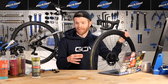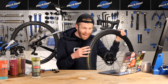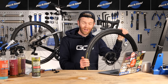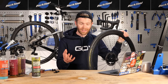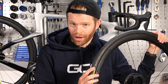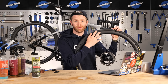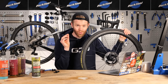To try and repair a tubeless system at that point is something of a sunk cost fallacy - you're investing time in something that might repair it while all your friends at the side of the road are just sat there getting frustrated. My recommendation is that 95% of the time it's better to simply replace your tubeless setup with an inner tube to get you home. Cut your losses, take half of the tire bead off so that you can insert an inner tube, inflate it, and off you go. Don't waste time doing something that might fix it - just do something that will fix it.